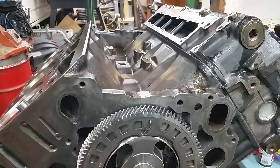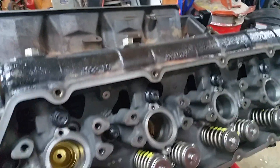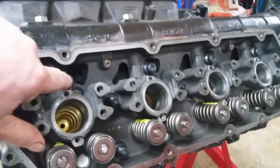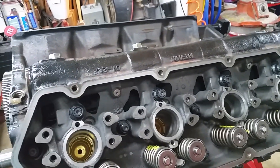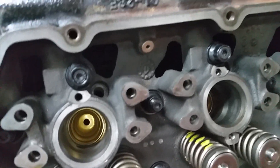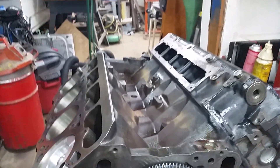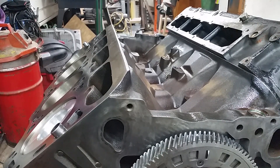I ordered a new gasket from RockAuto. I didn't record how this first head went on but we will record the next one. These are all torqued down - those are the ARP studs. There's a requirement: you have a short stud about a quarter inch shorter than the rest that goes in front of the injectors so that when you put the injector in the stud's not in the way. If you had one of the longer studs with more thread hanging out it would be in the way of the injector. So we'll have a new gasket on its way.